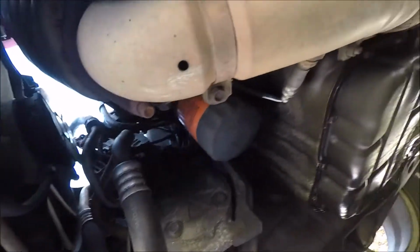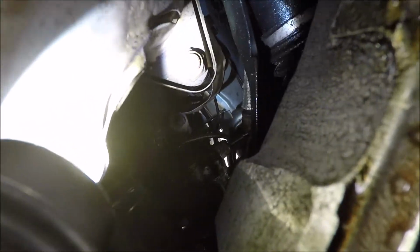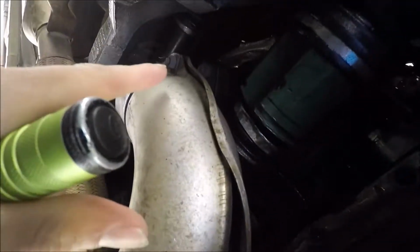Then you're going to want to pull the bottom exhaust. It's these two bolts. I'm gonna pull the sensor out. You're gonna have a bolt here, a bolt there. Then you have these two right there for the hangers, and then also your other sensor. Right here. There it is. I knew it was somewhere. Go ahead and pull that out. And the back two bolts behind that cap right there. I can't really get to them at the moment, but you see them. Basically, this kit is going to replace this whole pipe right here, this manifold, and that manifold.